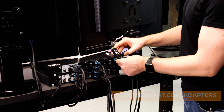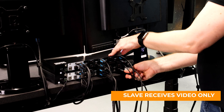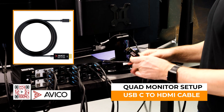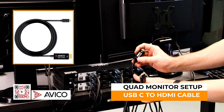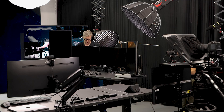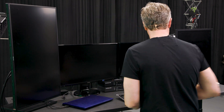We come here to input A and plug in our USB into the master, then plug in one DisplayPort to HDMI cable and then the other DisplayPort to HDMI cable — plug that into number three. For the fourth video connection, we're going to run that to the front with a USB-C to HDMI cable. As you can see on the cable itself, it actually says USB-C to HDMI right on it — same with the DisplayPort to HDMI cable, so you always know which way the cable adapts from and to. Let's plug in our USB-C, run that to the front, and put this little placeholder in. Now let's go back to the front of the desk, put in our fourth video connection to the Yoga, and finish the setup.